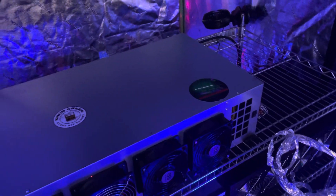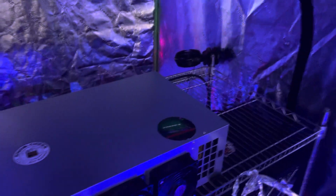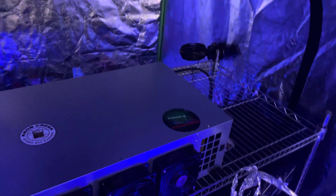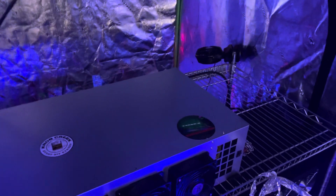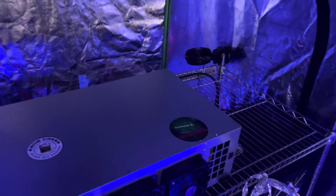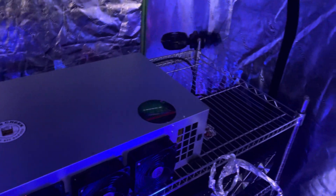Update: as you saw in the previous video, I bought that EVGA open-box 3080 Ti. It was a piece of shit — bottom line. I changed the paste, changed the pads, and no matter what I did it was always at 70°C and the memory was overheating. And that was even outside the tent. I could not get that thing to work, and it was just so tiny compared to the other ones.